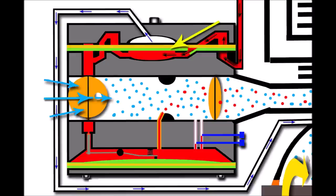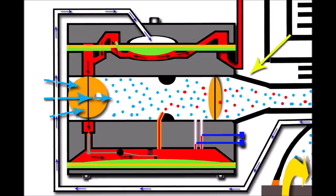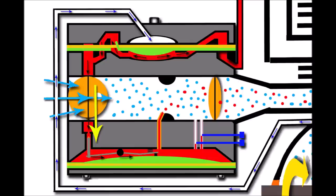There are many more points I could make on this subject, but the last point I want to cover is regarding the metering diaphragm. We know that when fuel is drawn out of the main jet, it increases the vacuum in the metering area, drawing up the diaphragm, which pulls back the needle valve off its seat, allowing more fuel into the metering area for the main jet to use. If there's slight damage to this diaphragm — not 100% damage which would stop the engine entirely, but semi-damage — then instead of the diaphragm being drawn fully upwards, it will only be partially drawn up.